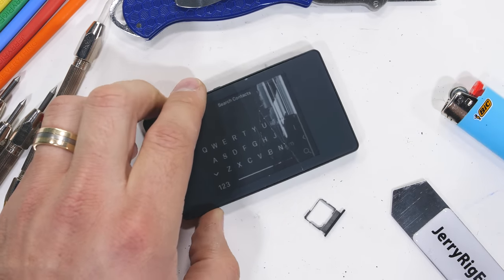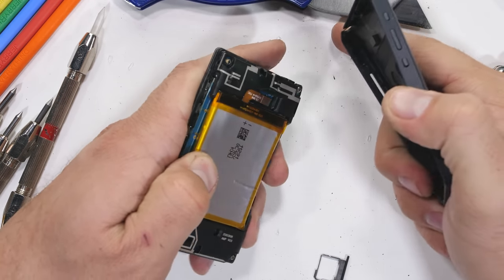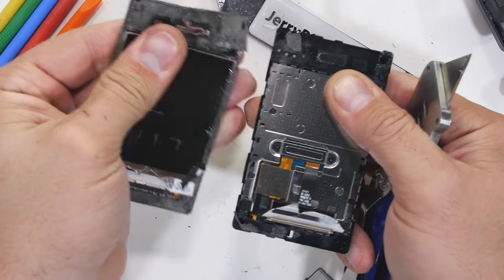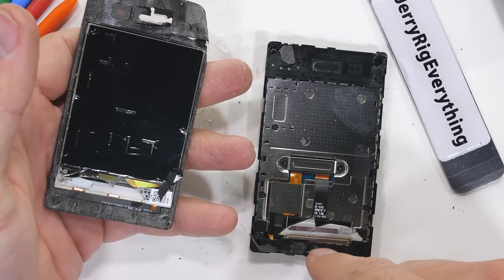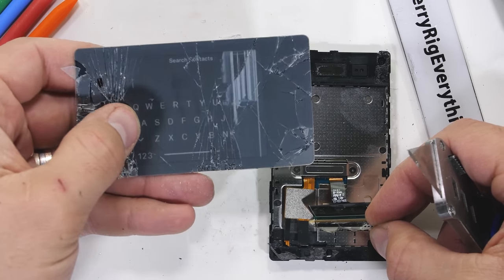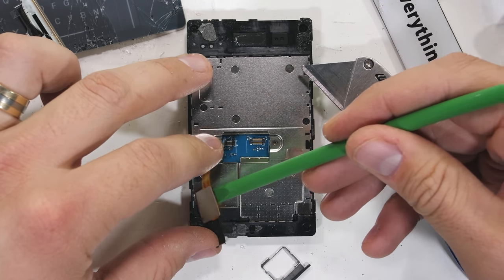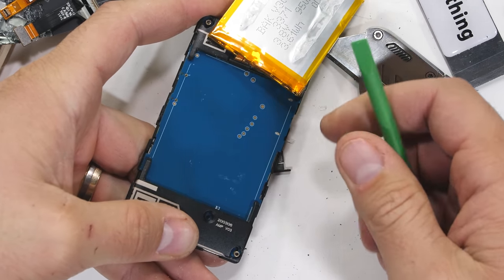Since we're already this far, we might as well see what else is inside this little guy. Initially I thought the whole back housing might just pop off like we've seen on some other cheaper Android phones, but even though I was successful with brute force, that turned out to be the wrong way to open it up. With the plastic back housing forcibly removed, we can see that the screen is glued to a battery and mid-frame sandwich. The correct way would have been to remove the screen first with heat and gentle prying, then unscrew some screws. Even now with the e-ink screen completely detached from the phone, it's still displaying its final frame even though both screen ribbons are ripped completely off.